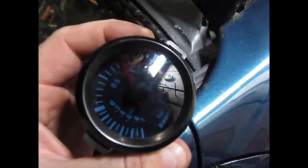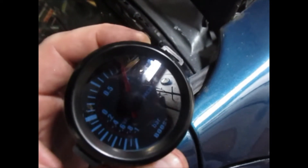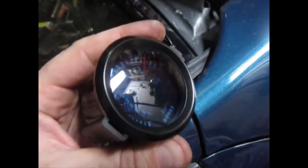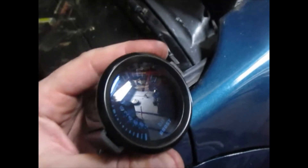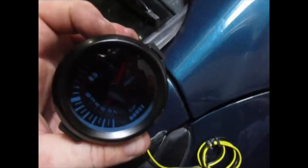Keep going — 14 and a half. Hold it there for a sec. 15 — one bar boost. Ladies and gentlemen, one bar, 1.1. That's good, that's more boost than I'm probably going to run for a long time. That's about 16, 17, 18 pounds in the intake manifold. 18 pounds here and 25 pounds going into the turbo. Boost gauge is maxed — just about maxed.